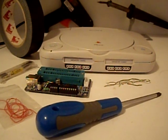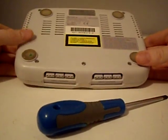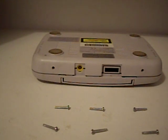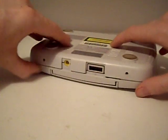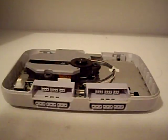We're going to make a clear way and start to disassemble the PS1. As you saw in my last video, if we have a look at the PS1, there are 6 screws — 3 here and 3 at the top. The one is hidden underneath this warranty sticker, which we're just going to pierce through and unscrew. So that's our 6 screws removed. They're quite stiff to remove as they were put in by a machine when the unit was assembled. Put them somewhere safe, we'll need them for reassembly. Then open the PS1, put it on its front and just lift the lid like so and put it somewhere safe.